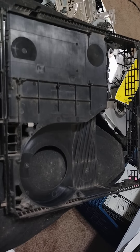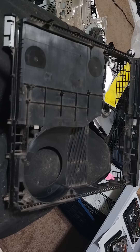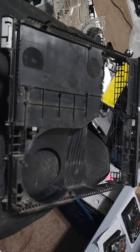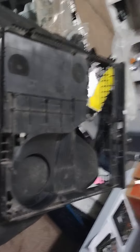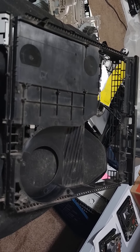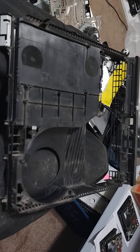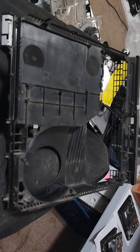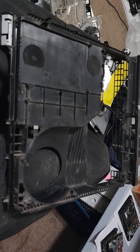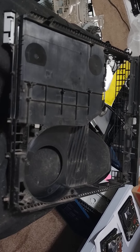Although my pants are now covered in dust, the chassis is now clean. The fan test is good — it's not the healthiest, but it is good. So we'll go ahead and put that back in, get the now clean heat sink back in. We'll wait for the compound when we're assembled, so let's just get the fan and the heat sink back in. Then let's do the HDMI port.